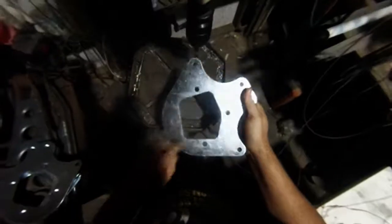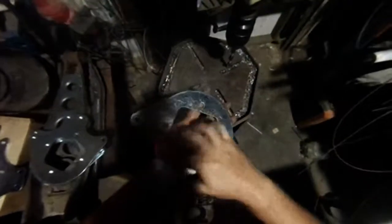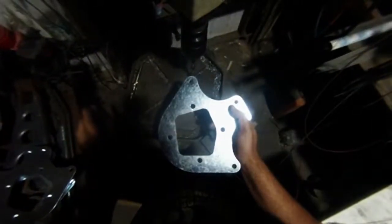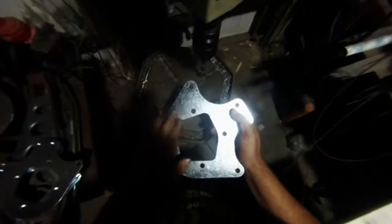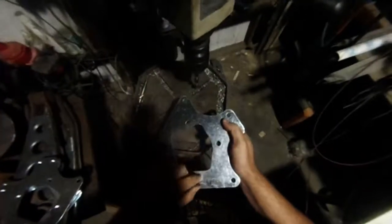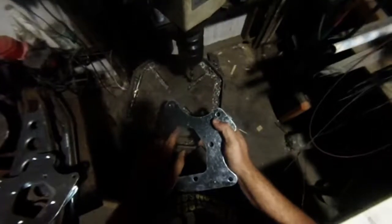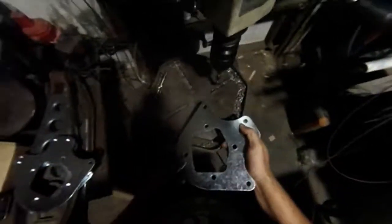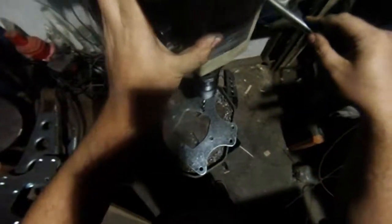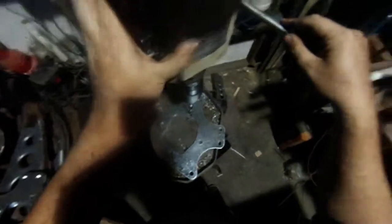So another job tonight, because I've got to drill the 4 holes for my R31 GTST rear adapters out to 10.5mm. Because I cut the files over and over again. When I sent the file in originally, I didn't allow clearance for the bolt, so they cut them 10mm instead of 10.5. Every other set I remembered to drill the bolt hole out before sending them off to get plated, but this set I've missed out on it, so I'll have to do it now, just so I can bolt them all up and send them out when they get purchased.